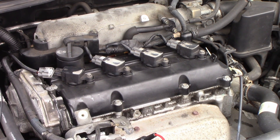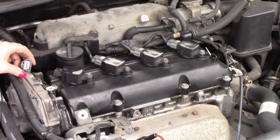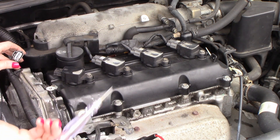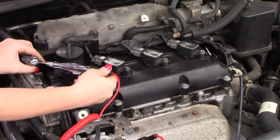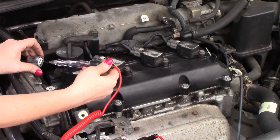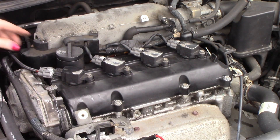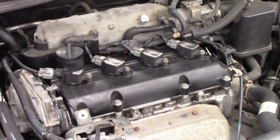One of the things I wanted to include when I was doing my Spanish version was load testing the ground. I know we have power — at least ghost voltage — but it might not be a complete good test since it's not load tested. But here we can see we have good ground. All I'm doing is lightly touching the middle pin. I'm connected to the alternator — to the negative post on the alternator because it's closer. We're going to check the power side with a slight load — it's only 250 milliamps.